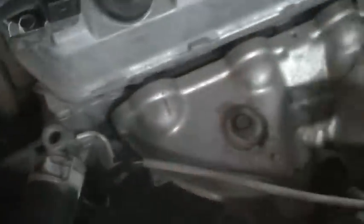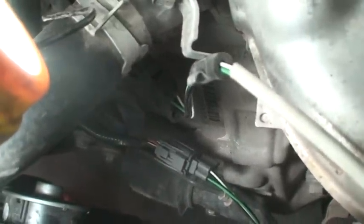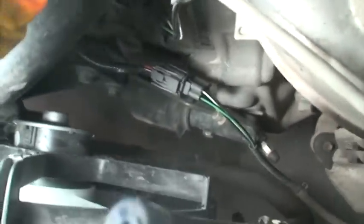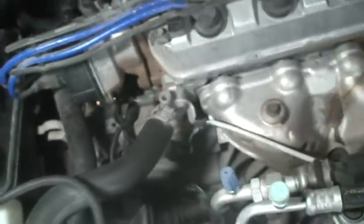We did that, and up on top there's also this slave cylinder. This black thing right here is a little rubber boot that covers your shift fork. That's what the throwout bearing is connected to - it engages the pressure plate and keeps the pressure plate disengaged from the friction material. This is a hydraulic pump - the slave cylinder - it's run by a master pump and as far as I understand uses the same hydraulic fluid as your brakes. It's a hydraulic pump that moves that shift fork back and forth, allowing you to disengage the clutch. You throw that back on and put your boot back on your shift fork.